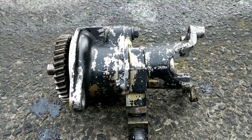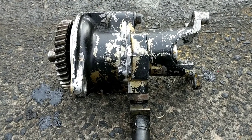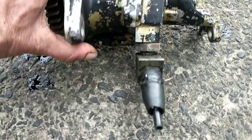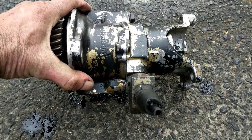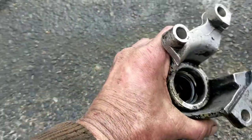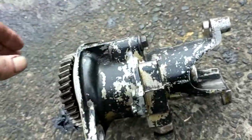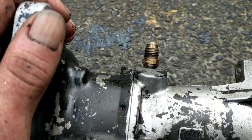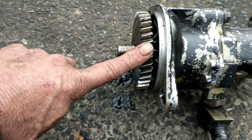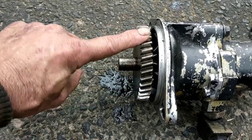There it is out — still a bit of an oily mess, so clean it up well; you don't want dirty oil getting inside and contaminating the new seals. One thing I didn't mention: there's a simple vacuum line at the top that just pops off. You can see the square interface where the power steering pump bolts up, and the oil supply line — that's under pressure, pumping oil inside to keep everything lubricated, then it drains out the front where the gear is, which is driven off the timing and front gear assembly.